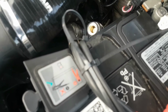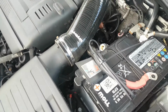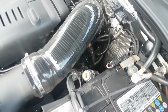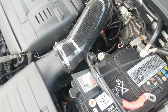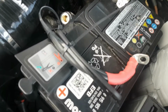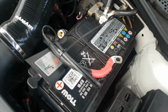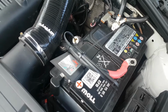So now I know I can push 200 amp. If there was a problem, it should blow at 250 amp, especially with the extra battery in there now as well. So as I say, I had one power cable. It was grounded to the seat belt. I had to sand back some of the galvanized metal in order to do it. I would never recommend it because I had problems with my radio system.